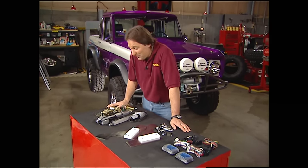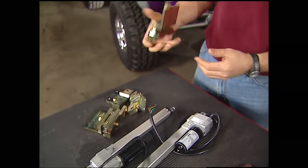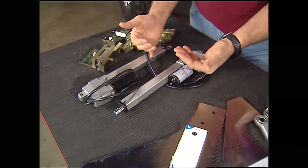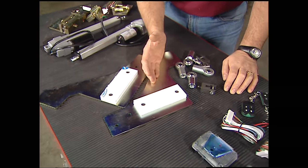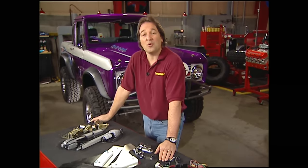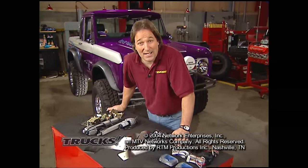In the world of custom trucks, one of the most popular areas to modify is your doors. You can chop them, shave them, gull wing them, roadster them, suicide them. Now you have yet another choice because Autolock has come out with this Lamborghini door kit. This will modify your doors to where they'll flip forward like a Lamborghini Countach. The secret to this kit is in these special hinges, then you have linear actuators to lift the door for you, plus all the brackets and hardware. You can even get a remote system so all you do is push a button and up come the doors. If you want your doors to open like an exotic, you need Autolock's Lambo door kit. That's it for today - we'll see you next week.